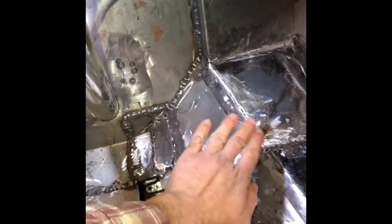So what I'm gonna do today, I'm gonna show you guys how I determine how long my brake pedal should be and how I'm gonna maximize that room in the floorboard. Check it out. The first thing I had to do was totally rebuild my transmission tunnel. When I first built it, this was just straight from here down, and I discovered there was just no room in here. No room to put a foot, a pedal for a brake, pedal for a gas. So I reshaped my whole transmission tunnel. Lesson I learned on that was don't be afraid, man. Don't be afraid to break out the cutting wheel, cut things up if it isn't right.